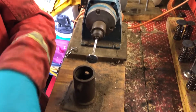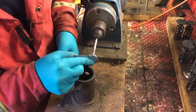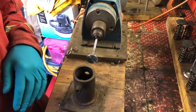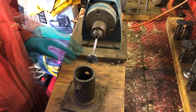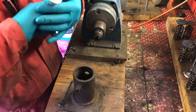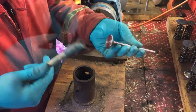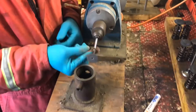Then I've got a bit of 180 to just polish the top - get a wipe over. Got to say, that valve does look a lot more bent now it's clean. We'll double check that, but having cleaned it up, there's a nice shiny surface and the plunger will now stick to the valve so you can lap it. Onwards - I'm going to do the rest of them now.